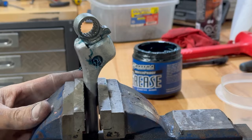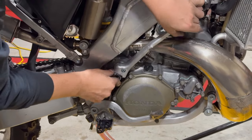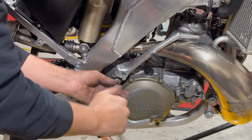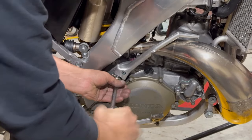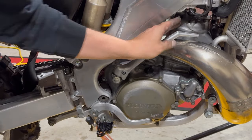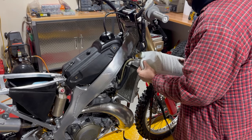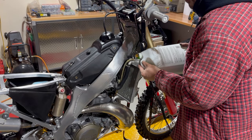We take our screw and simply reinstall it, tighten up and snug. Then we install the kickstarter. We had to order a brand new bolt from Honda because the previous owner had the wrong bolt — there's no washer, it's a bolt with a big collar on it, a special bolt. If yours doesn't have it, it's about three bucks — buy another one. Now the rads are all mounted and all the hoses are hooked up. I like to top up the coolant system and get it taken care of so we don't forget, and also to check if anything starts leaking since we fixed the water pump.